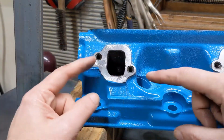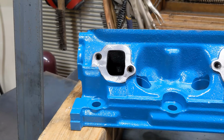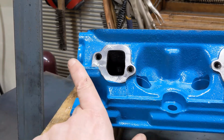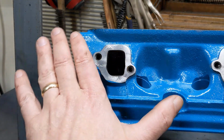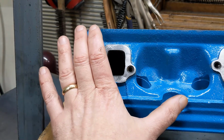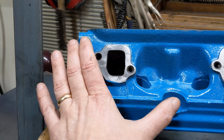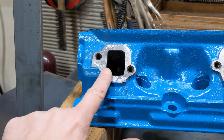The reason for this is this head is just so wide that it doesn't fit really well onto the mill. When you're working all the way out at the end, the mill is all the way to one side on the table, and all of the weight is tipping the mill. So when I'm running the hand wheel, the motion makes the mill rock just a little bit. That rocking motion translates through the mill and ends up giving this kind of a finish on it.